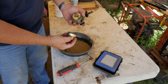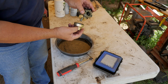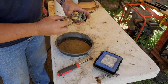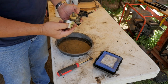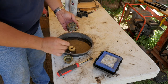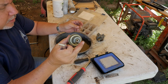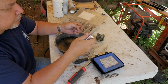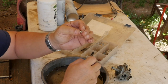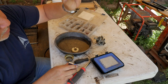Doesn't look bad at all, does it? But it's got to be this one in here, because the bowl was full. And when I turned it over, if this needle valve wasn't clogged, fuel would have been coming out right — but it was barely coming through. I'll just take it all off to get it out of the way. It looks pretty clean overall. Let's just take this out and clean it. You can see the bowl was very clean. I took everything off, took the center valves off, and this was the main culprit — usually at the very tip. The emulsifier tube is usually pretty clean, but this was clogged also.